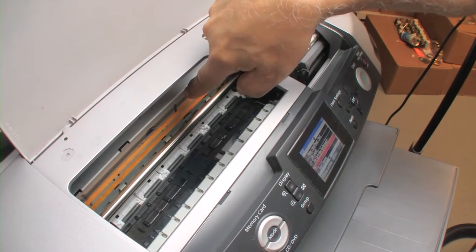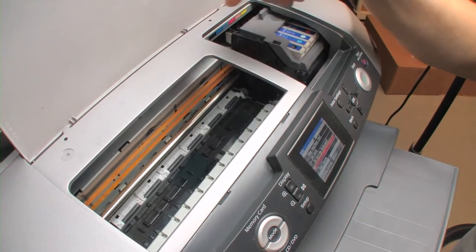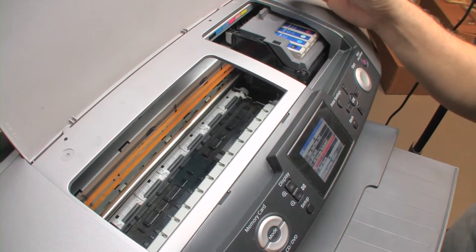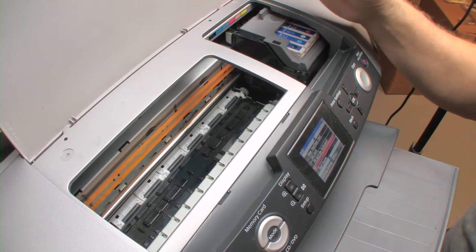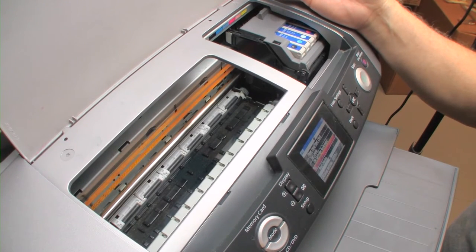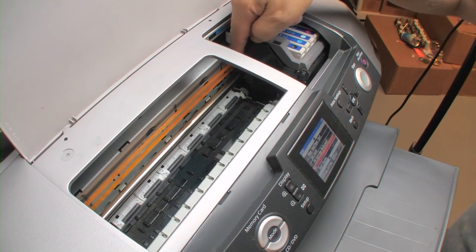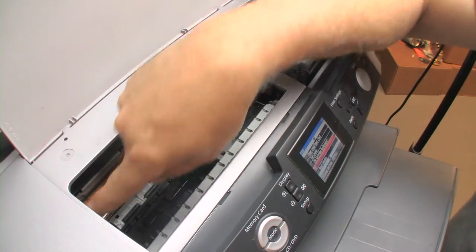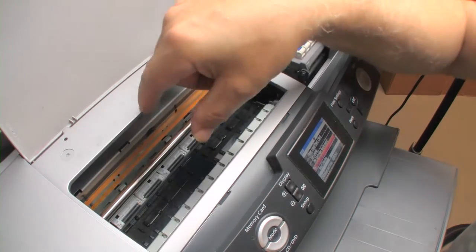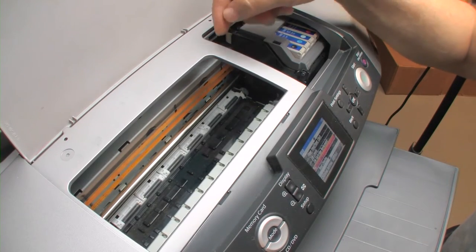This head alignment will tell us one thing: whether that encoding strip I showed you in the earlier video — located right here — needs cleaning or not. If it does, we'll perform that. If it does not, I'll show you with a dry Q-tip what needs to be done. They sell special little foam-tip cleaning sticks — like those used to clean old VCR heads — still available on eBay from overseas, though they take about three weeks to arrive. They have a little flat applicator head; you apply cleaning fluid — just alcohol — and go across the surface left to right. To reach the right end you move the head to this position, then do the same on the rear portion.